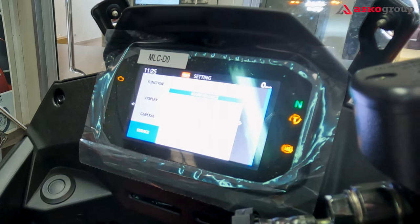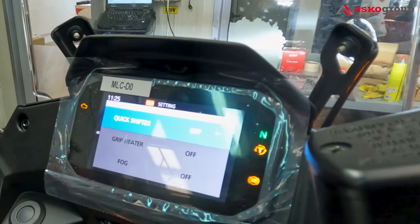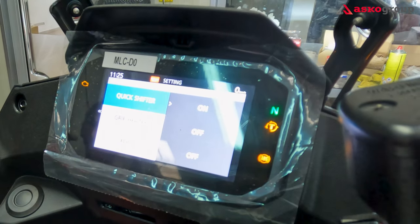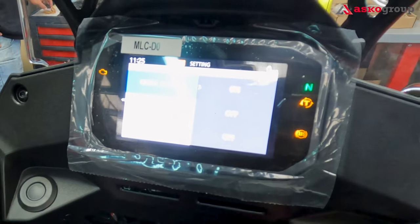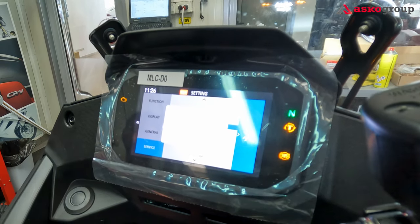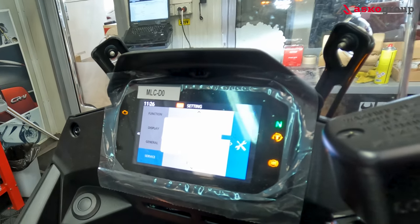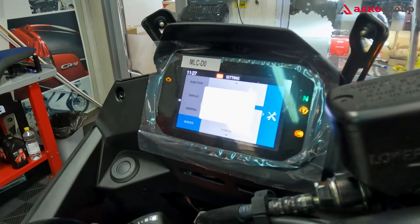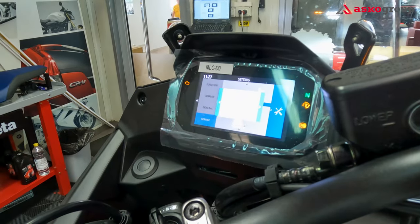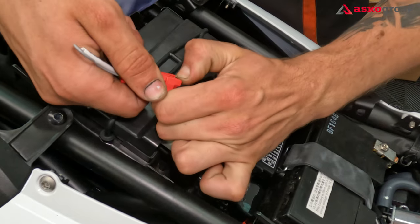Let's check it out — Maintenance. Look at this: Quick Shifter, Initialize. Quick Shifter — and now you have the options to turn it on. Here you can also activate the grip heater and fog lights. Preparing for initialization — the sensitivity of the quickshifter is recommended to be set as high as possible. The reaction of the quickshifter should be placed at maximum in order to protect the clutch. Preparing for initialization — and now the quickshifter is initialized. You have received the message: Initialize Succeeded. Now we take off the connector after the quickshifter is initialized.